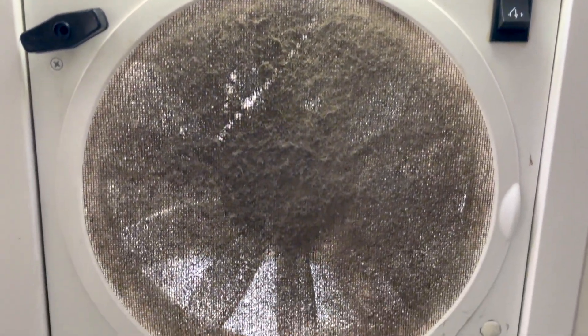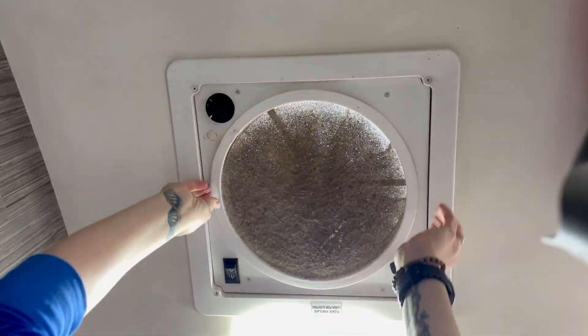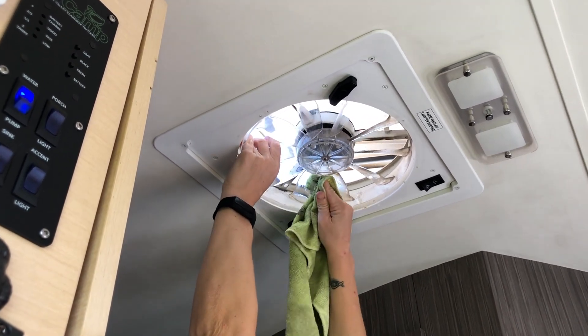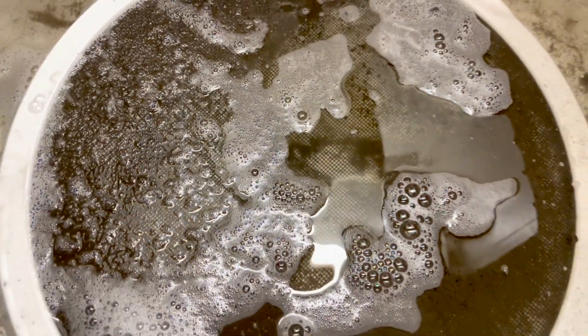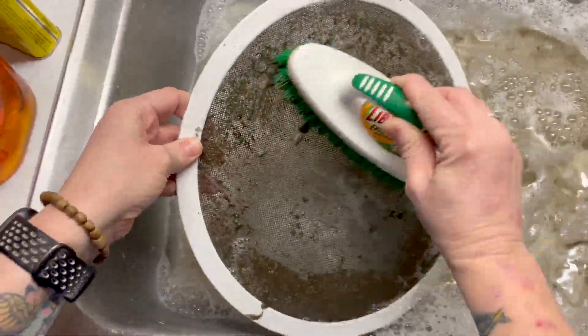This next one is kind of a gross one, but I guarantee if you haven't had to clean yours yet, you will — let's talk about the ceiling fan. After several months of camping or living in it, that thing is going to collect dust, dirt, and grime from cooking. But the good news is if you carefully get your fingers around the edges of the screen, you can pop the whole thing off. Once you've popped off your screen, you have easy access to clean the fan blades or just get to work on the mess. The key is to soak your screen in a degreaser — it could be 409, dish soap, or warm water — soak it for a while, then use a little brush to brush all that grime off. And voilà, like new.